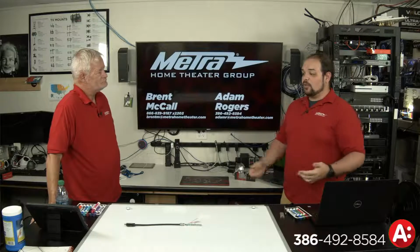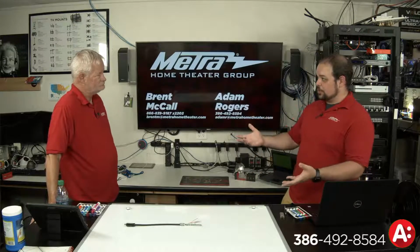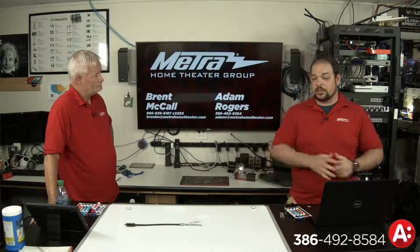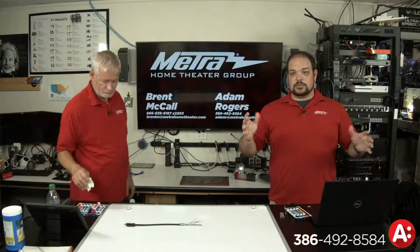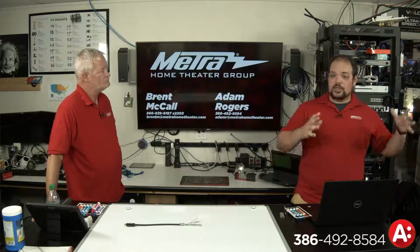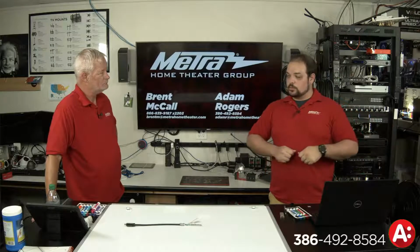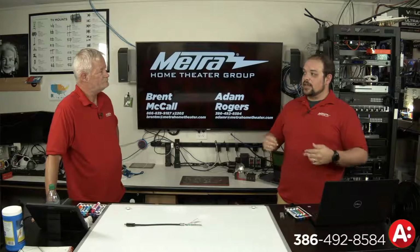Now when we move into HDMI 2.1, a lot of times it goes back to the twist ratio and gauge. When we develop an HDMI cable, we go off to manufacturing and get it made, and then chop it up and put ends on it and send it out. When it's made initially, it's on giant spools with thousands upon thousands of feet on one spool, and then from there it's drawn out to 3 meters, 1 meter, 15 meters, however long, and then it's cut.